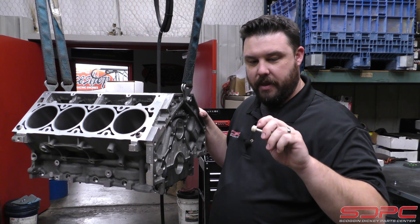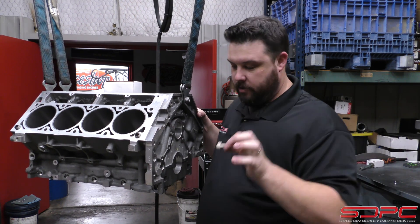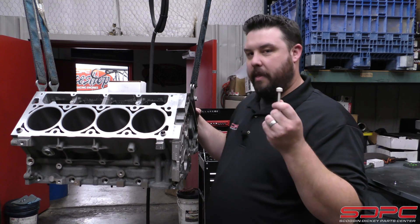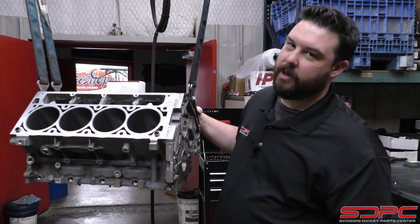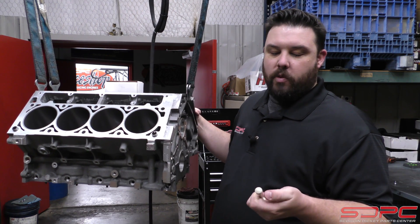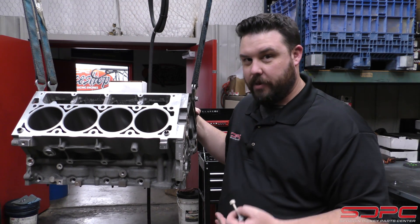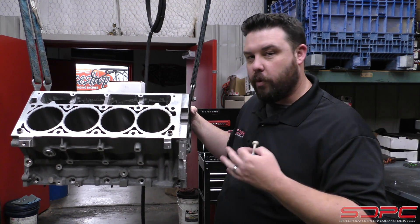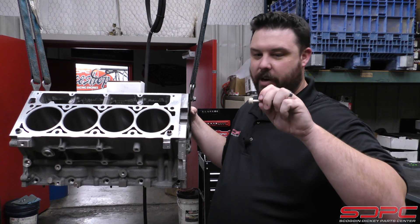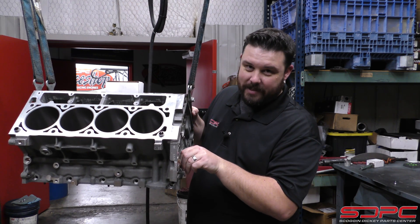What's the point of having these little ridges on it? Why not just have another plug in the back? Well, the plug in the front diverts the oil into one of the oil filter passages so it can come back up the other side. Without that, it would be sealed, but you would never get oil through your oil filter — it would just bypass it every time. If you're wondering why it uses an O-ring, GM engineers did it like that for a couple of reasons. On the off chance something really crazy happened — oil filter got plugged, something broke — you need at least some oil being fed into the engine just to limp it home. It can bypass just ever so slightly. They actually did make it a pretty tight fit; once it's installed, it does a pretty good job sealing.